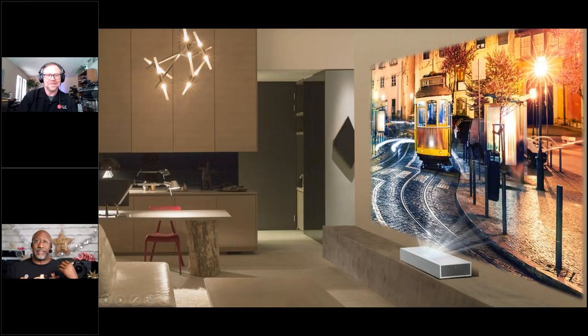So we want the low maintenance and the brightness of a good laser source. It has to be smart. And then the last challenge was, I don't want to have this thing behind me that's going to block the picture, and where am I going to hang it in the back? And that's where the ultra short throw comes in. The ability to have this projector a few inches from the screen in front of you and still project this gigantic picture. That is the last part. But the whole thing about ultra short throw is the optics.